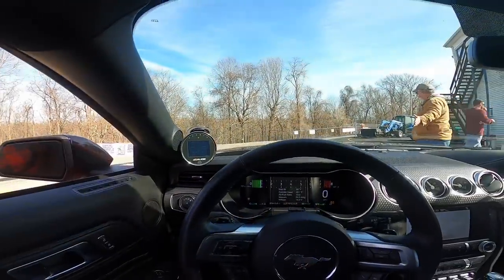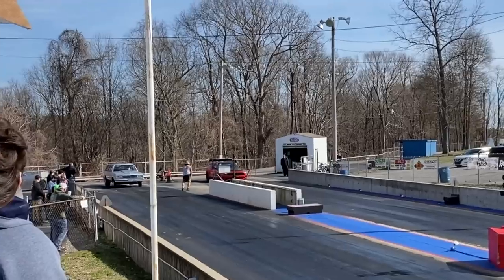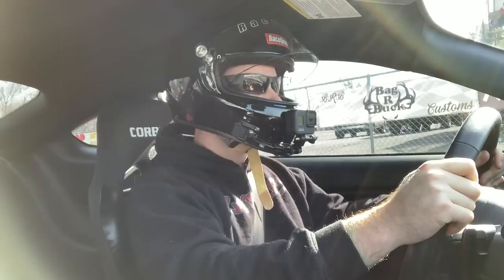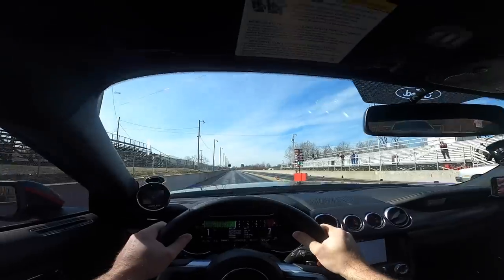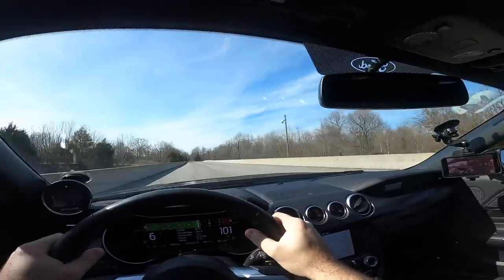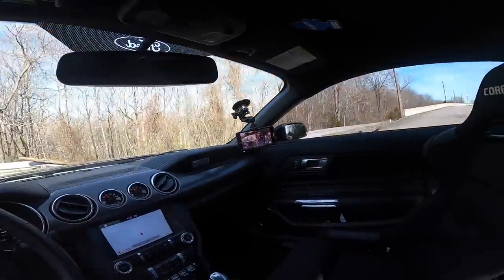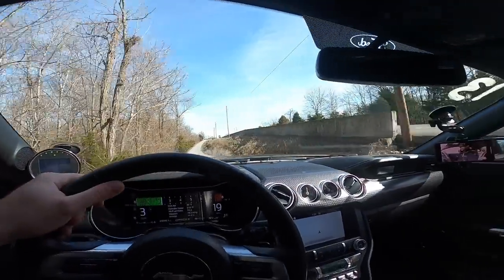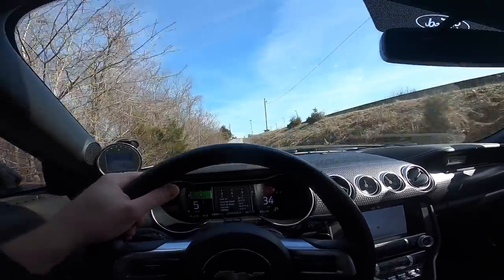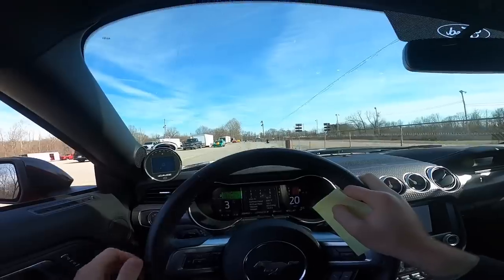Are we turning it up? No, I'm gonna try to stall the car a little higher. I had to get out of it — it started going sideways on me. Oh, the shutdown — that killed the time. That's fine when you're out of it. Sometimes you can play with the gas and get back in it, but I stayed in it just so we could see. That's going to be a butchered pass, but hopefully the 60-foot will tell us a lot more since we took the stall up a little bit higher. Oh, this feels good.